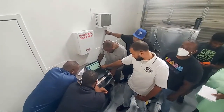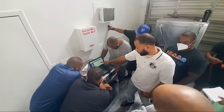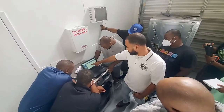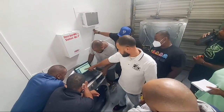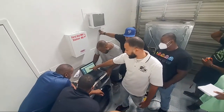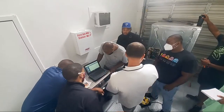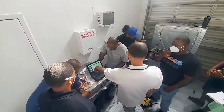I want it to go right to the board with no interruption. So it's coming off this line, it's going over that cable. Remember I was saying it goes over it. And then it goes to CN, the connector. The pin is 5 and the color is red. So that's our L1, CN70 pin 5.